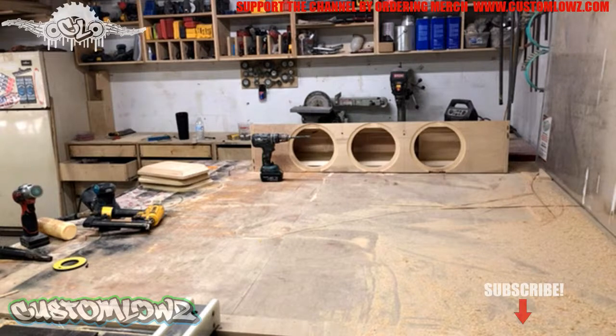Now, it definitely probably sounds scary to you, 25 square inches for 3/10, and you're talking about doing 4/8 and 35 square inches of port area. But again, in the underseats, man, you're really just trying to get the best you can with your given circumstances. And under a seat in a truck, you definitely have some limited circumstances. Normally, I would never do 3/10 under a seat. Thankfully, the Fords don't have a center hump, so that makes it a lot easier when it comes to, first of all, fitting it on the baffle of the box, but also, that hump does take out some airspace. Not a ton, but enough.